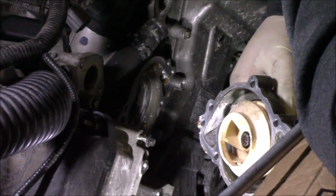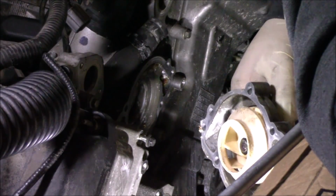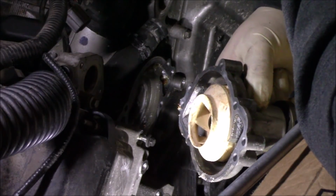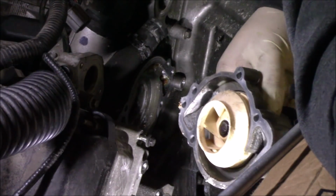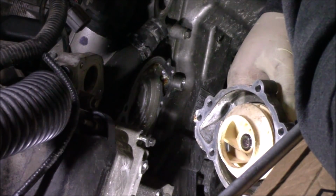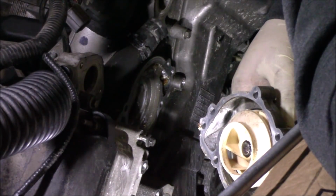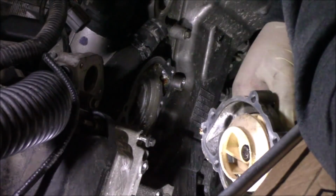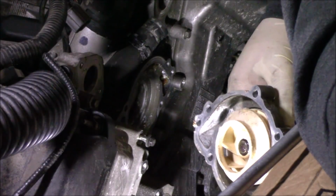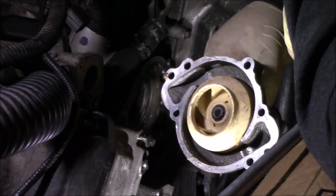I've gone behind other people in other shops before for head gasket issues, and a customer is still having an overheating issue and they're getting ready to get rid of the engine because they think there's some odd problem, but it's really not. I've torn the engines back down and checked the warpage limit and it's way out of spec. Send it to the machine shop, get the head flattened, and put a good quality gasket on and some new head bolts, and problem solved. So never use this head gasket sealer stuff if that's what this is. It doesn't work.